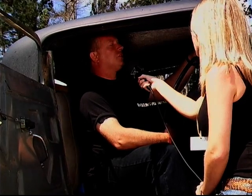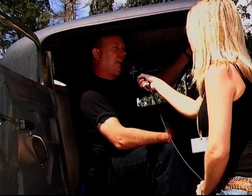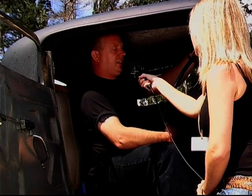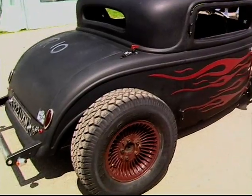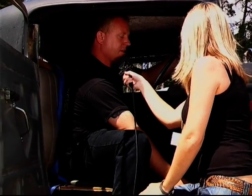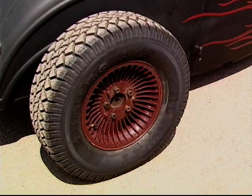The front axle is a Super Bell, and everybody has a spring on the top. Well, I've put my spring on the side to get the chassis even lower down, and on the back, where the chassis goes over the axle, I've put another chassis over the top of that chassis. I then cut out the original chassis so I can get the chassis lower over the axle. So we've got 6 inches out of the roof, 6 inches of the body going over the floor, over the frame, and the whole chassis is about another 6 inches lower than on a conventional hot rod as well.